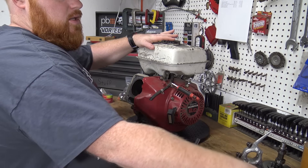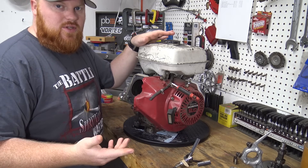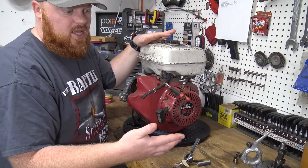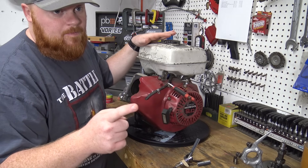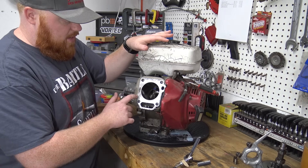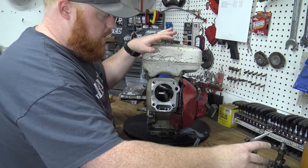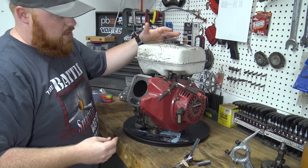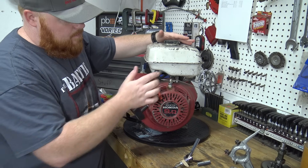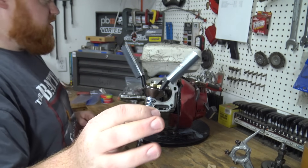Okay, so it's been a few days since we were talking about this old head with the exhaust stud broke off in it. Well, after making that video, I thought I'm definitely going to spend more at a machine shop to get that bolt out. So I went ahead and bought a brand new head for like 35 bucks, and that came with a new head gasket and new valves — much better deal. We need to hone out the cylinder, then put the stock piston back in. Also, once the piston's back in, I'm going to pop the flywheel off and do an eight-degree flywheel key to get a little more power. Put a little bit of oil on the honer — a link is in the description on Amazon.